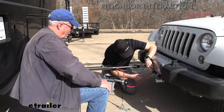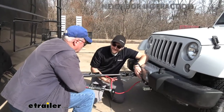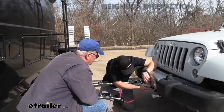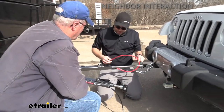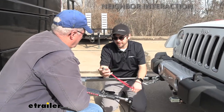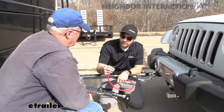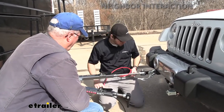To work the connector plug: you're going to have a little notch at the top, and an easy way is just making sure that little tab is pointed up. You work it out just like that. This cable can also drag, so when you're done and folding up the tow bar, make sure to store it somewhere out of the way. Check it each time — sometimes a connector can be hanging on the edge and get stuck, which takes way more time to get undone.